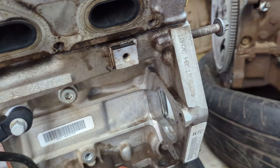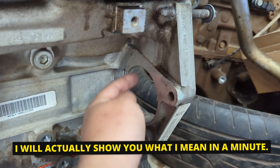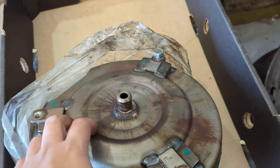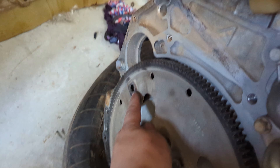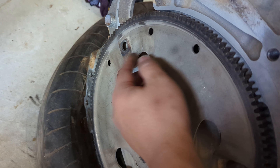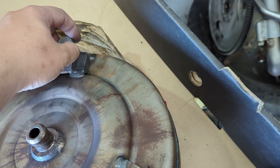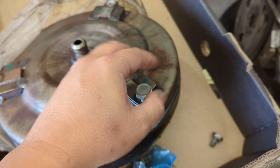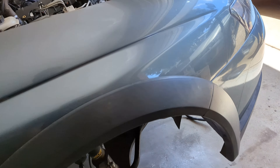What I'm doing is turning the crank so the flex plate is moving behind here. I'm trying to line these holes up on the torque converter with the holes on the other side. I'm coming in through this hole, and when this hole lines up to center, I'm putting this bolt through the flex plate, through the starter motor hole, and into the torque converter. I've got to do all three.